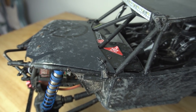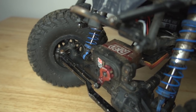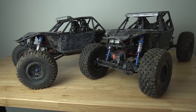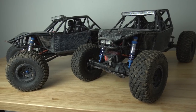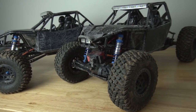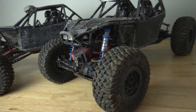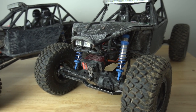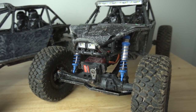I also have a light kit on this one. Running an R30 servo on both of them. I've upgraded to metal links, also from Amazon, on both of these. Stock brushed motor ESC combo — I did put a heat sink on the motor and a fan on the ESC to prevent overheating during Axial Fest. Bombers are kind of my go-to rig, super capable, can handle a lot of terrain. Honestly these are the ones I use the most.